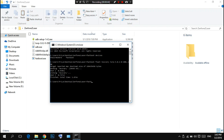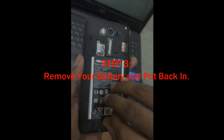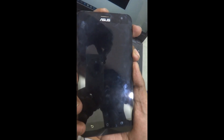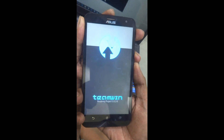Now we have to reboot our device. Remove the USB cable and remove your battery as well, then put it back in again. Now we have to get into recovery mode. To get into recovery mode, press the volume down and the power key together. You can release the keys and it will open our recovery — that is TWRP — which we have just installed.